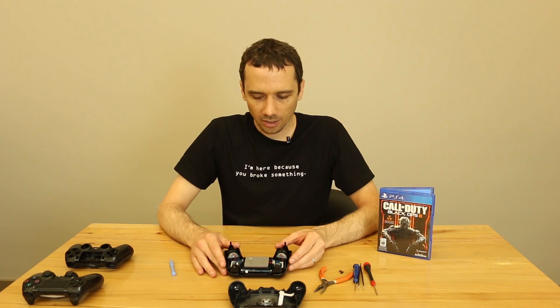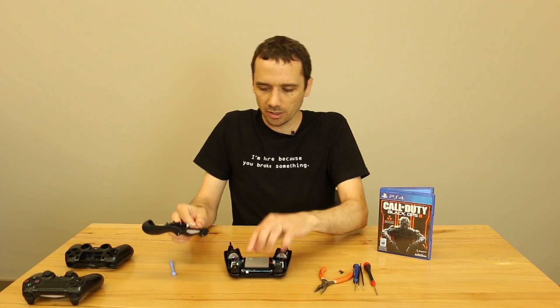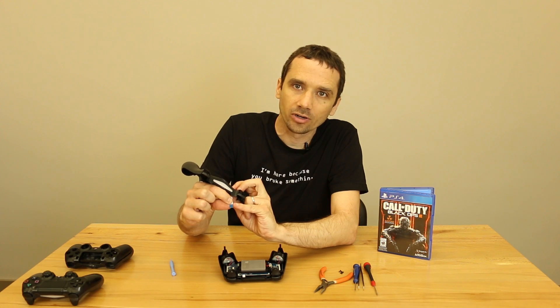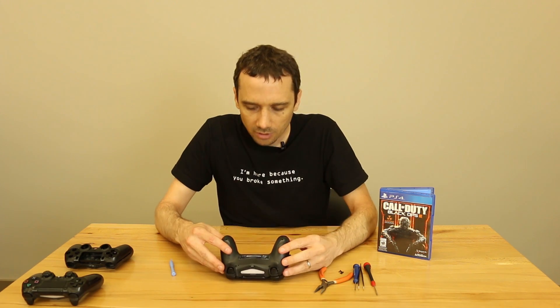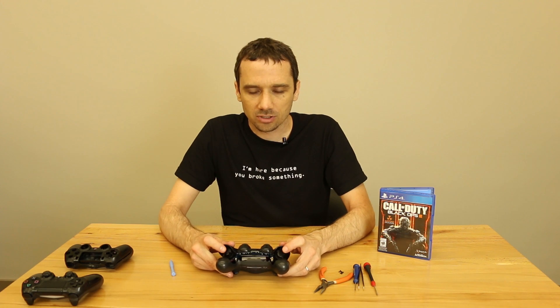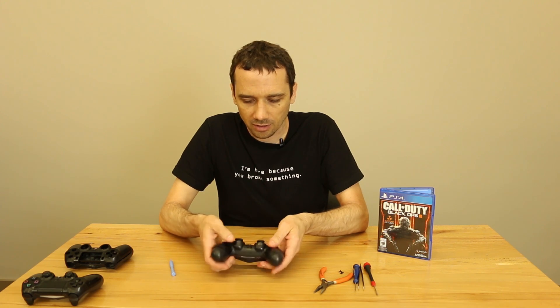So that's how you open it, and after that you can do what you need to do inside. Now to close the PS4 controller, we're going to grasp this ribbon cable right here — it's got to go back into this connector. In this one it just pushes straight in; it's got a bit of hard plastic there, the dark blue, so that's going to go straight in to the connector until it bottoms out. Now you're going to want to get these lined up correctly with your trigger buttons — the trigger buttons are going to go through the controller right there. Before this gets all the way lined up and pushed down, we have to push this back together. These long plastic pieces are kind of hitting there, so I'm going to pull that under like that to get it to go down there.